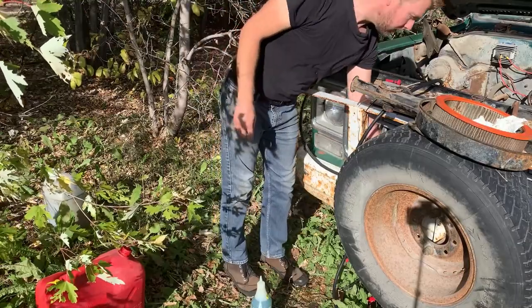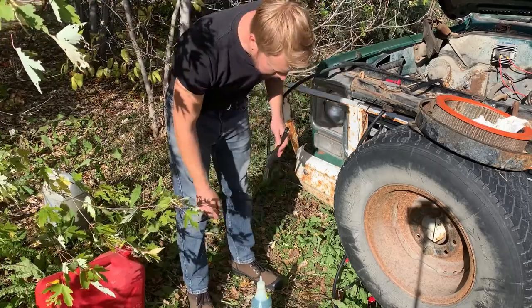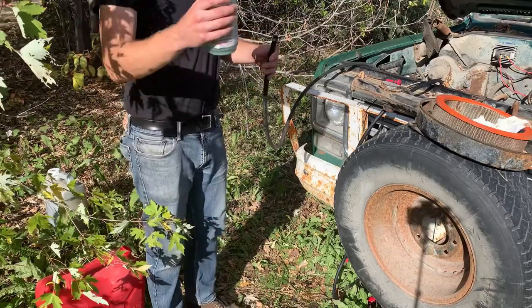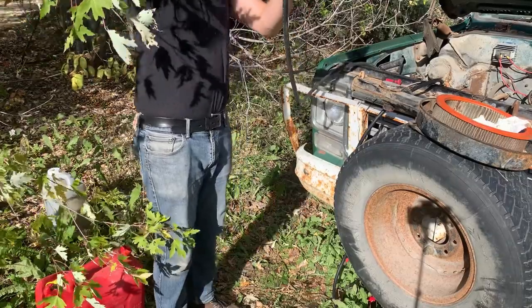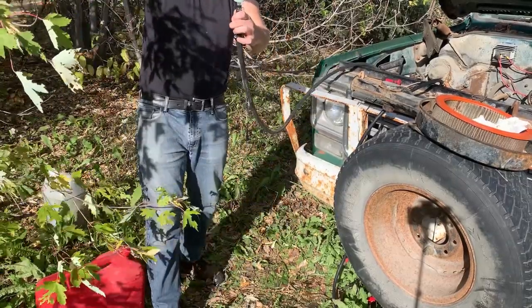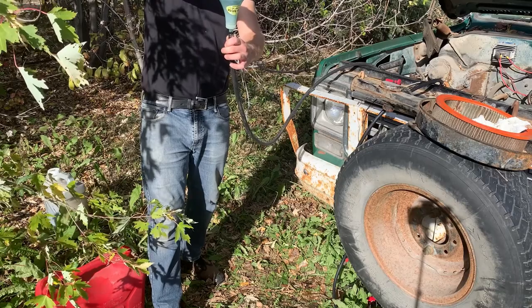Since this fuel system was already pretty much disconnected, it's gonna take me all of 12 seconds to hook up my own here. Before doing so, I like to take some of that two-cycle oil mixed gas stuff, just kinda lube up that diaphragm in the fuel pump, you know. Just let her gurgle down there and sit a few minutes, and again, every little bit helps, right?